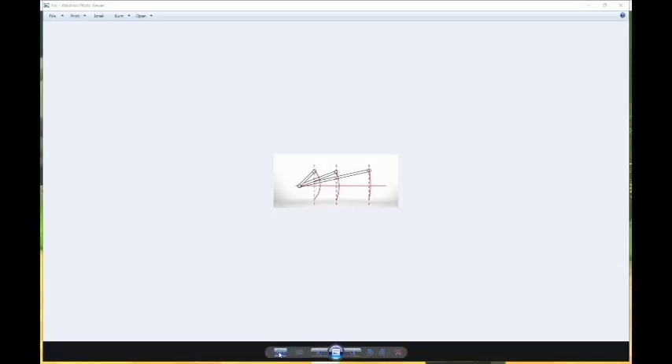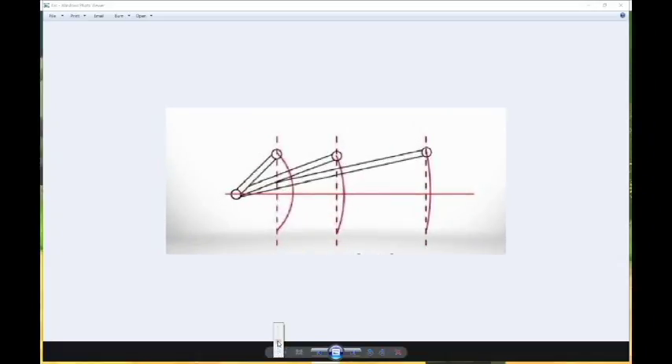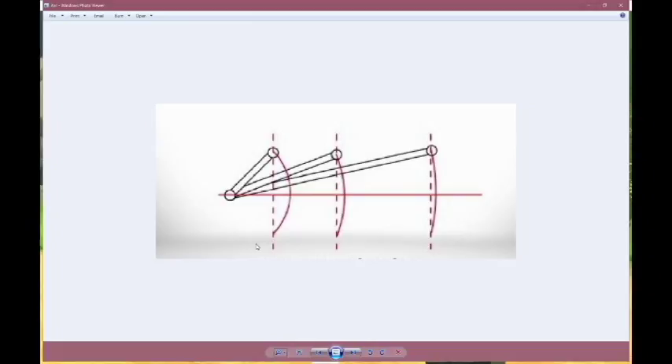This is really low resolution but pretend this is your axle right here, and up here it's attached to the chassis. The shorter the bar you have, the more the axle moves to the side as your suspension goes up and down, so you want a longer bar so it moves less.